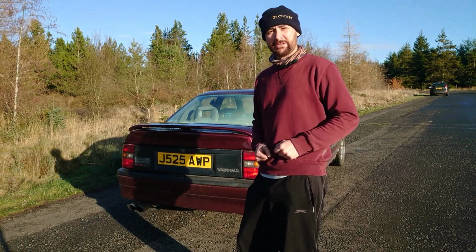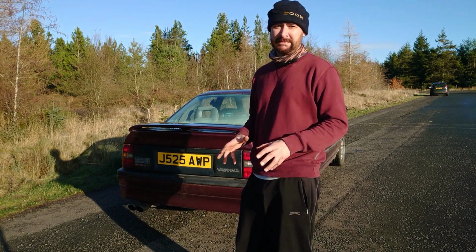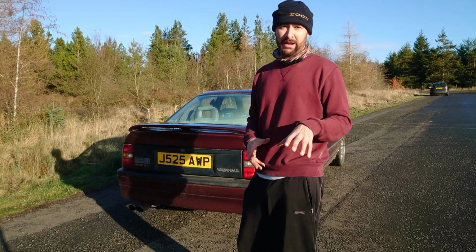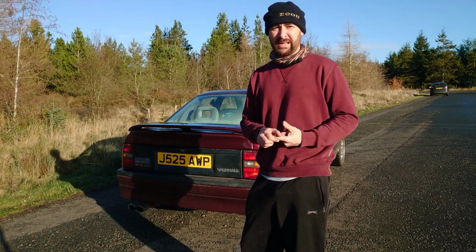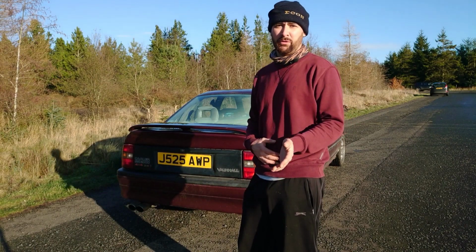I bought a complete Cavalier V6 for spares, and we took everything out of that that we needed, and got it running on the standard Cavalier four-wheel drive system, which at the time meant F20 four-wheel drive gearbox, which was 5 speeds close ratio, which wasn't ideal. It didn't suit the character of the V6 because it was revving so high on the motorway.